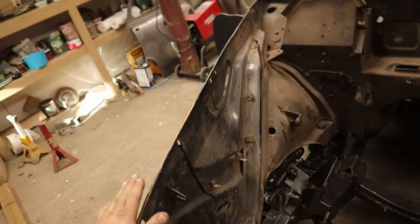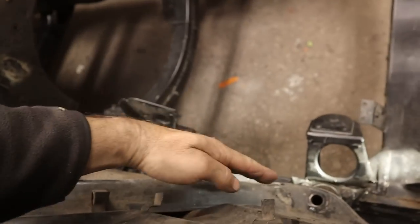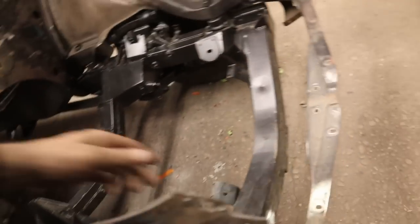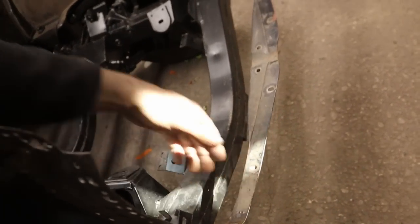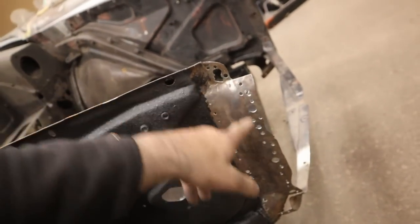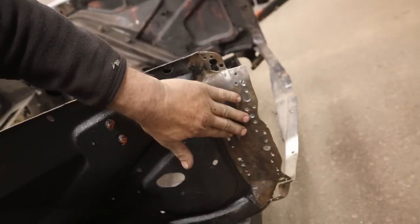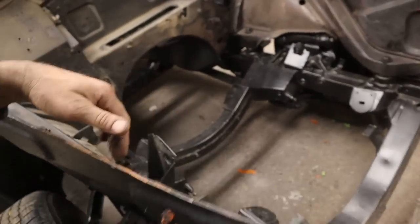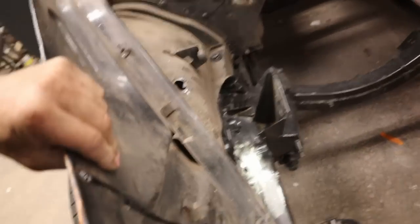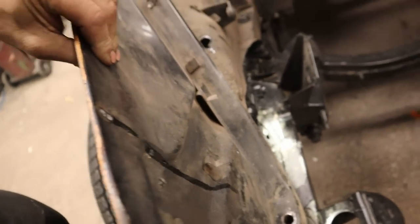Unsurprisingly, this corner where the original accident damage was, you look from the top, it's not lining up at all. Now, because I've cut this away here to repair all the damage in here, remember this was all folded up. So I've cut the stiffener off of there and I've ironed all that out. But there's some residual stress in the vehicle. But you can see it's not really very much. I could just push that over with my knee. So I'm not too worried about that.